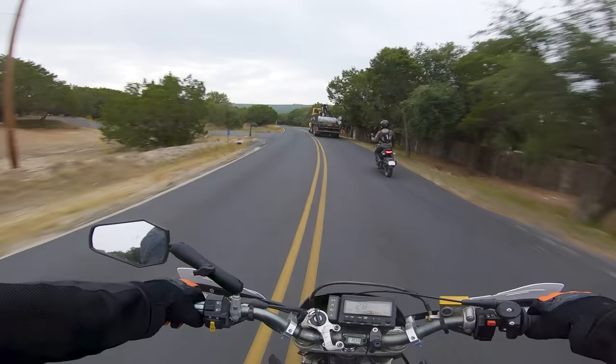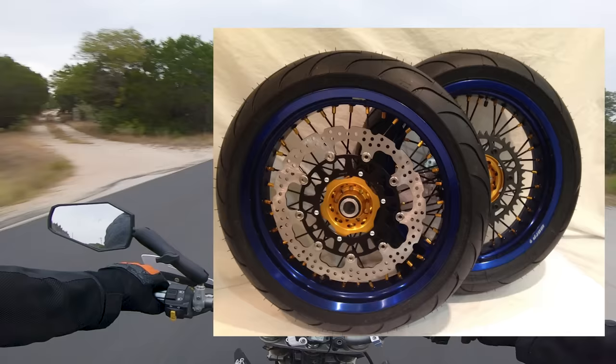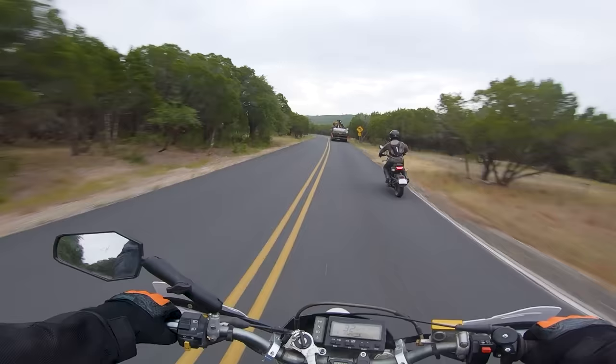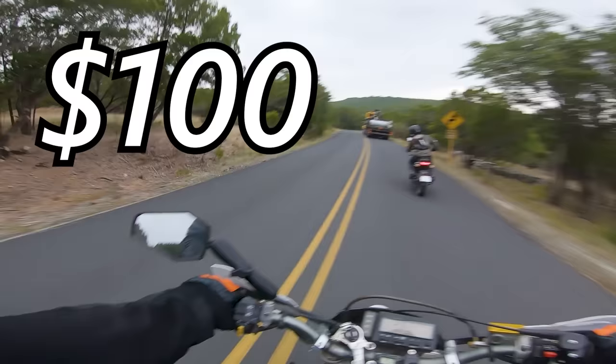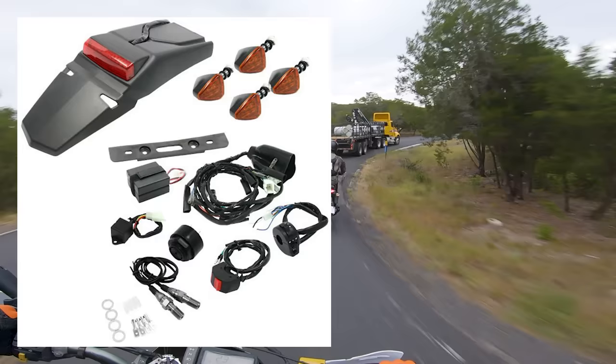If you want to rip a 450 on the street anyway, here's what you're going to need. First, a set of 17-inch rims — that'll set you back $500 to $800 for a nice set. Fresh rubber, call that $300. Then you'll likely need new brake rotors, caliper mounts, or even new calipers depending on your motorcycle — call it $300 for a good set of calipers, fresh rotors, and mounting brackets. If you want to do it right, you'll need to recalibrate the speedometer and tachometer, which on a lot of dual sports reads off the front wheel. Since you're going down in diameter, the speedo will read higher than it actually is — a speedo healer runs $100 or more, or you do the recalibration manually. Next, you need lights to pass inspection: taillight, license plate light, turn signals, headlight, high beam, and turn signal switches. Don't you just wish you bought a bike from the factory at this point?